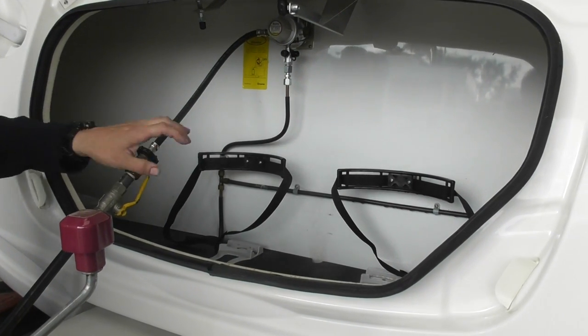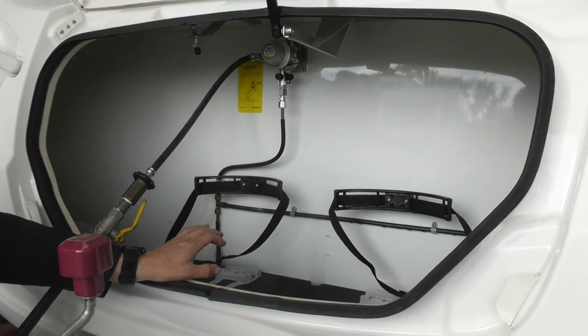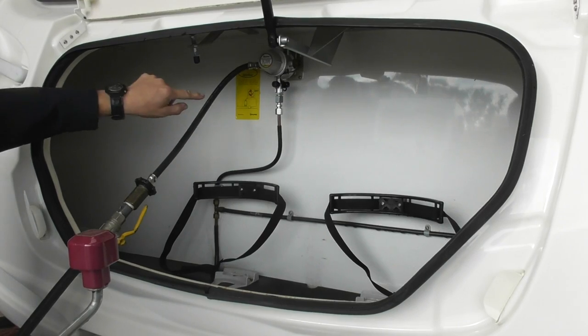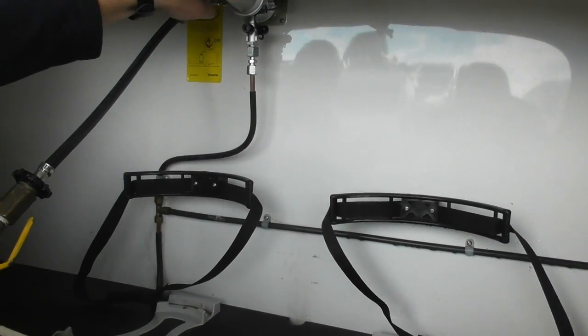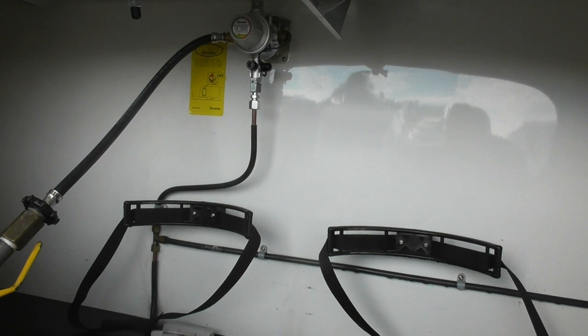Right, so if you wanted to, you could attach two gas bottles. So if you use a lot of gas, you can have both connected up and switched on. You see this arrow there, that's pointing to this one at the moment. So I'm operating off this side, obviously we're off all gas at the moment. And there's a little indicator at the top to say we've got pressure. If it's green, it's got pressure, so we've got gas. If it's red, then it hasn't. Either that or you haven't turned it on.